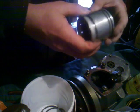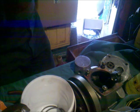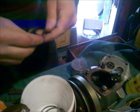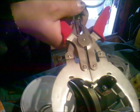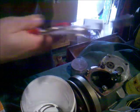the compressor. So now this is the procedure how to put on the piston rings back. I have to reuse the old parts. I cleaned them up with brake cleaner, and now we'll put them on with my piston ring compressor. Put it in. Always keep in mind to put it on the right side. There's a marking, top.